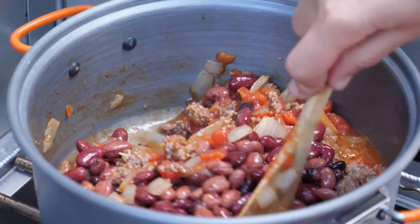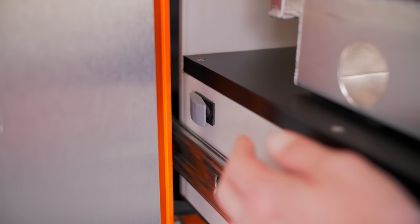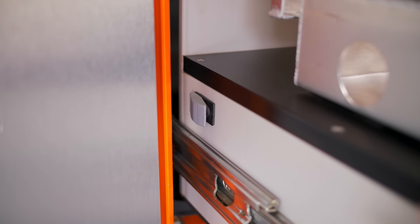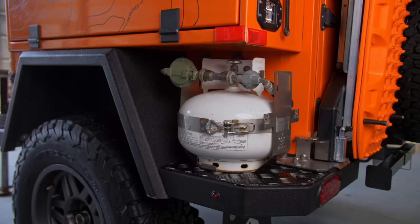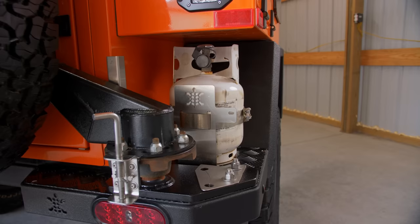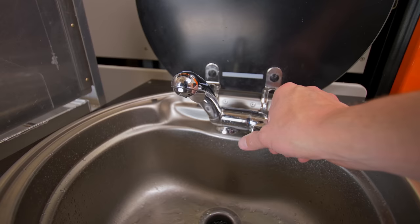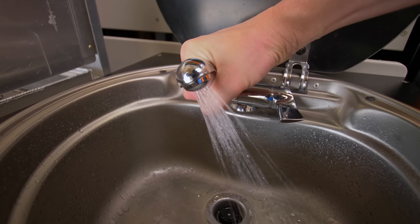Not to leave safety behind, there is also a gas protection circuit which will cut off the fuel supply if the kitchen is slid back into the trailer. To activate the gas system, simply turn on the safety circuit, press the gas supply switch with the slide in the proper position, and it again becomes pressurized. Both the hot water heater and the stove share their fuel supply from an 11-pound propane tank fitted to the rear fender area. This capacity is usually enough for a 7- to 10-day adventure. It's also equipped with a backup tank, which can also be used for a campfire pit or other accessories, such as a propane heater.